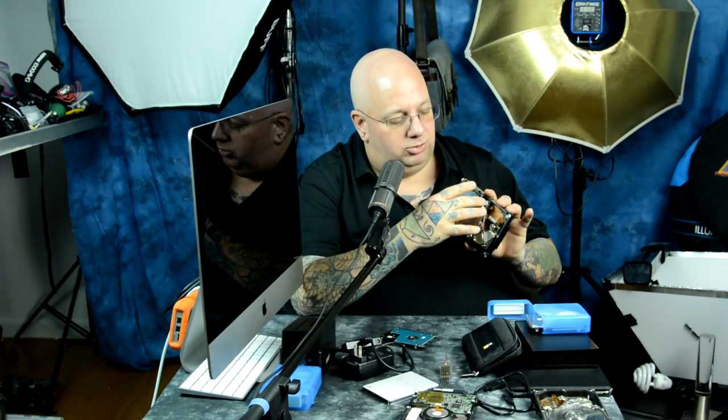The hard drive may not survive very long because it won't be sitting perfectly, but it'll survive long enough to get the data off. It doesn't matter if you leave a fingerprint — you'll still be able to read the data; it just won't survive long-term. This is only for recovering the data. You remove the entire platter system and swap it out — you're being Victor Frankenstein. This is exactly what the people who charge you a lot of money do: they find the exact same hard drive, swap out parts until they find the failure point. The voice coil and armature go back and forth over the platters like this. A hard drive is both very simple and very complex.